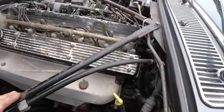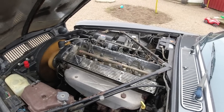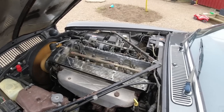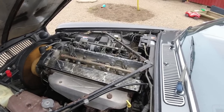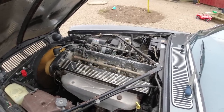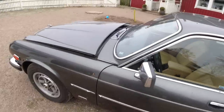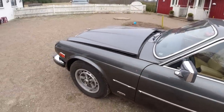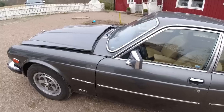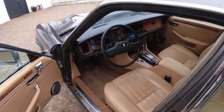You can clearly see now the whole engine is shaking. What we're going to do — step one — I think it could either be ignition-related, or it could be a vacuum leak, or something with the throttle body. We'll drive into the workshop. I've grabbed a couple of spare coils I have laying around, so we'll just quickly put another coil on it and see if that makes a difference, and we can sort of rule that out. It almost sounds like it's going to stall now. It doesn't stall, but it is not that happy. Let me drive into the workshop — we'll swap out the coil and see if that makes a difference.